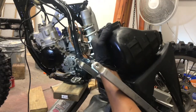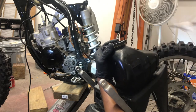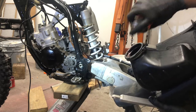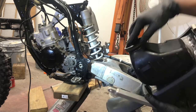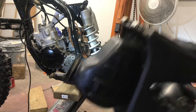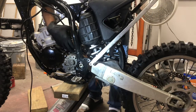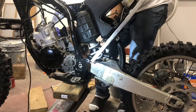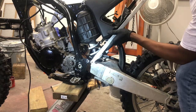Next we're going to be installing our subframe. We're going to loosen up this clip right here, and we have to lock our carburetor boot down. We're just going to spray the edge of it with a little WD-40 and get a little wipe around the edge so it can slip right in place. Now we're going to go ahead and install this on our bike — first we're going to focus on getting it on our carburetor. We got it mounted on our carburetor, now we're going to get our subframe mounted.